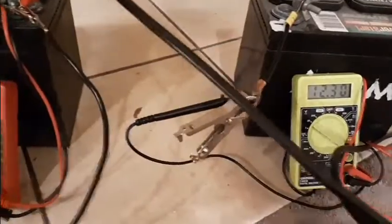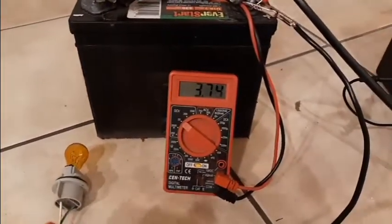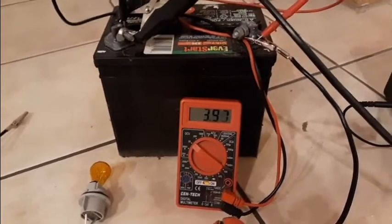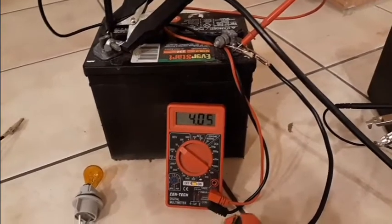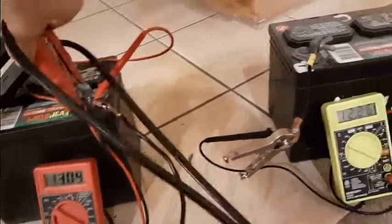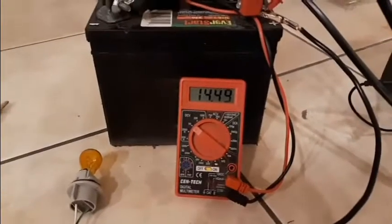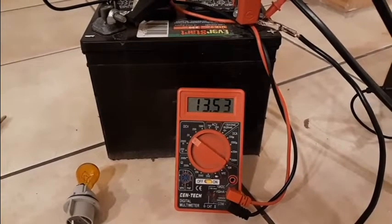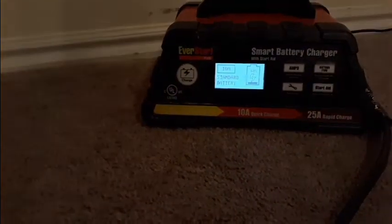Now this one is the alum battery, and I'm going to go ahead and stick the charger on there. The acid will probably come up a lot faster than the alum battery because it's got more acid — there's still some acid in that one but just a very small amount. I've dumped most of it out, so I'm not sure what the pH is. This one will probably charge up quite a bit faster. As you can see, this one's settling down. We're going to charge this one at 10 amps. Right off the bat they jump up to pretty high voltage — they're dumping 10 amps into it.